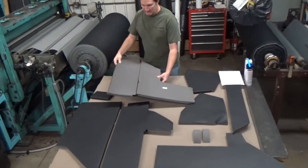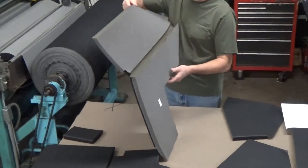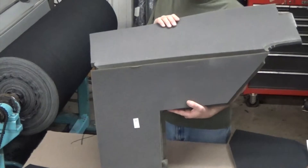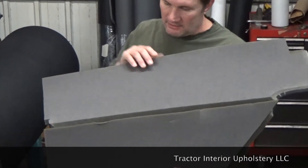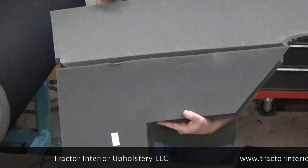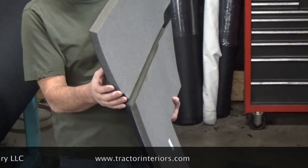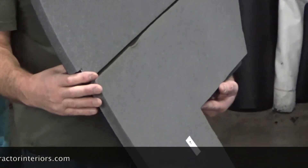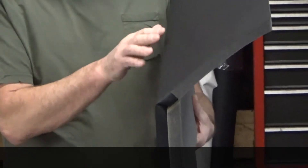Look at the back of these parts — they all have notches and hot wire cuts. These hot wire cuts are very useful. You can take this cut and line it up precisely with the bend in the sheet metal. This is the fender next to the door, and you can line that up with the bend so you know where you're at. Without this cut, which a lot of them don't have, they're just a flat piece of one-inch foam with no bevel — you don't know where you are for locating the part. So it's really good for alignment using these V-cuts, plus when you're finished you get a nice crisp corner rather than a compressed round corner.